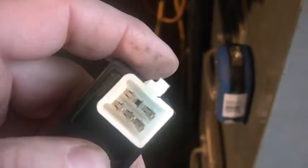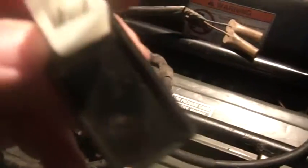The good news for Jamlover1 is these round plug CDIs actually seem to produce a hotter spark — they actually seem to work better than the square guys. I don't know why, they just seem to be a little hotter. That's in the world of plus. In the world of minus, should your CDI go bad, you'd need to rewire your harness and could throw one of these in. I'm not exactly positive — I'd have to go upstairs and dig up the wiring diagram — but if it became necessary, I can figure out how to wire this thing in if you run into that trouble.